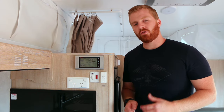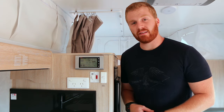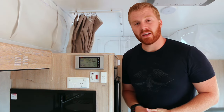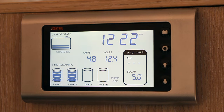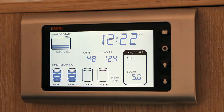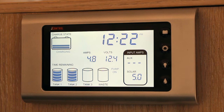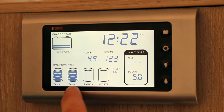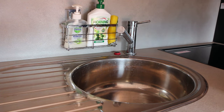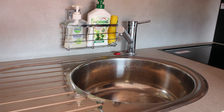When free camping you need to turn your 12-volt water pump on, which is done via the central control system. In 2018, Jayco was using the J-control, which on our van is located on the side of the fridge. From the screen you can see the pump is currently off. To activate it, simply press the water droplet icon. The pump will turn on, may need to prime, and then you have water throughout the van. You can also see the two tanks are full from here.